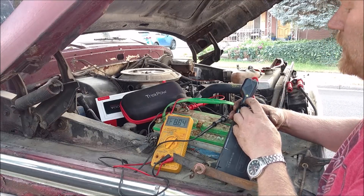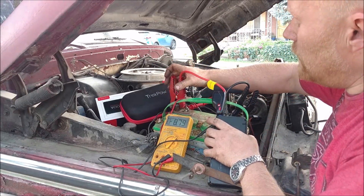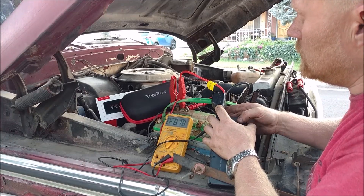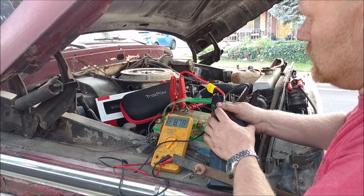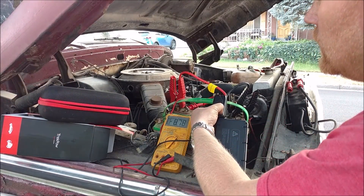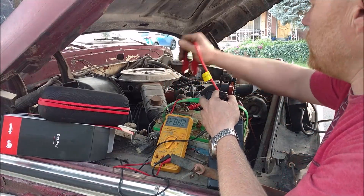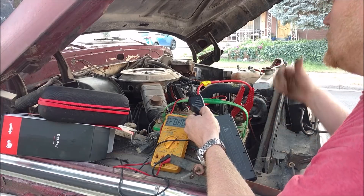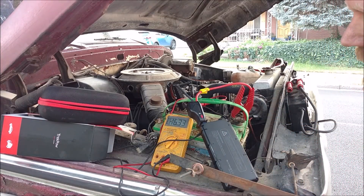There's a flashlight on it too. There's a button and a light — the light turns green when it's actually putting out voltage. I see it's turning red — I'm not sure if that means ready to go. Oh — I was reverse connected, that's why it's telling me reverse connected. Smart! There it goes — it's turning green now and it looks like it's putting about 16 volts into this. Let's see if she starts.